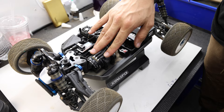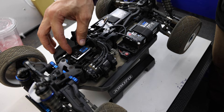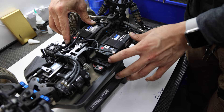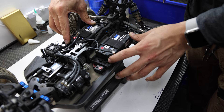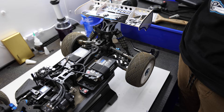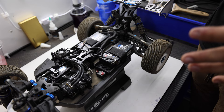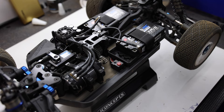The motor is not in the front — the speed control is in the opposite location compared to before. The servo is super tucked in toward the front of the car and closer to the centerline of the vehicle. The battery plates are in the back where you can choose your battery position. After yesterday's e-buggy main, I really like positioning the batteries all the way back to get more weight to the rear. This will be a tuning option for different track surfaces and conditions. The setup otherwise — shock oil, pistons, etc. — is pretty much the same as the nitro car.